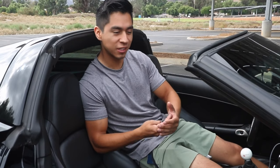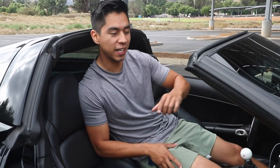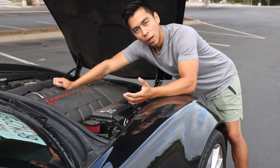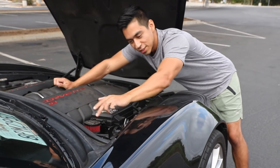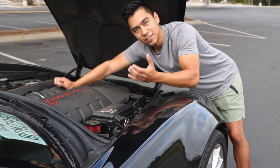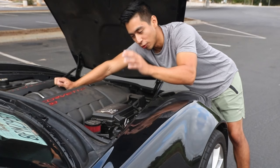If you want more performance mods, I'd recommend upgrading the intake, injectors, coils, and maybe the throttle body. The good thing about the C6 is those things can be done fast and easily. If you live outside of California, you can also throw headers on this car — it'll sound better and perform a little better. If you're pushing more power, I'd recommend getting a catch can system like this one I have here. It keeps the intake clean and traps excess blow-by, preventing oil contamination.